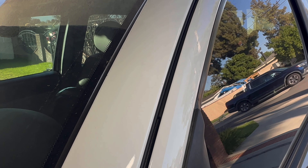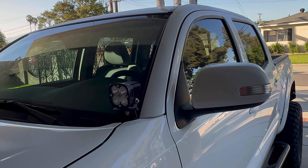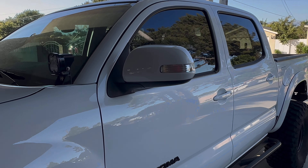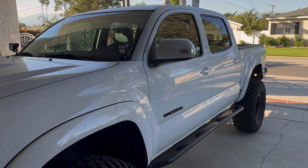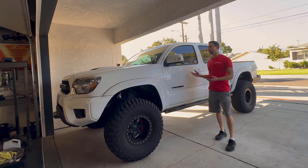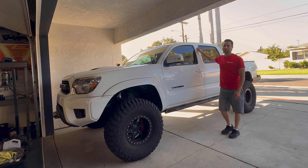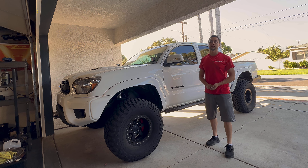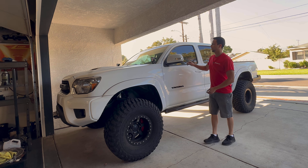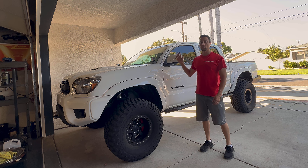That is the updated TSB seal. If you don't have that tube, it will just be the little flap, which is going to make noise in crosswind conditions — that's really the only time I ever experienced it, but I wanted to get it all swapped out while doing the whole soundproofing project. This is just the icing on the cake for that project. On a difficulty scale, I'd say two, just because some of the clips were a little bit of a pain on the door seal that goes around the perimeter. Installing the seal between the front and rear doors was a one — almost a zero. Just make sure you clean it with alcohol or a degreaser, otherwise it will not stick. Same goes for the portion of the seal that takes tape. Everything else pops in. Do the other side, call it a day, and enjoy less wind noise.